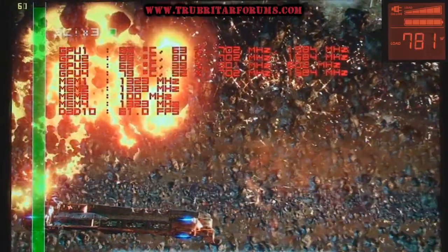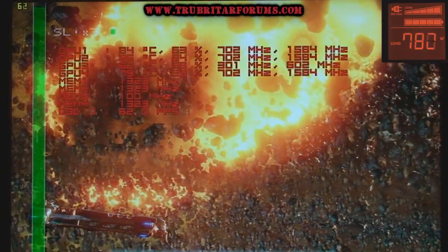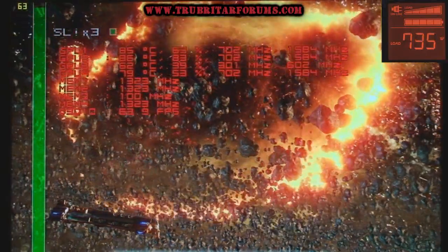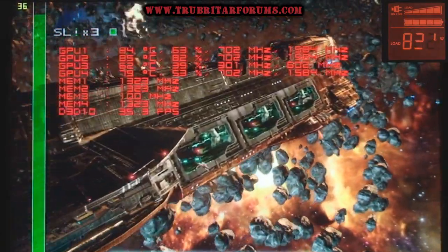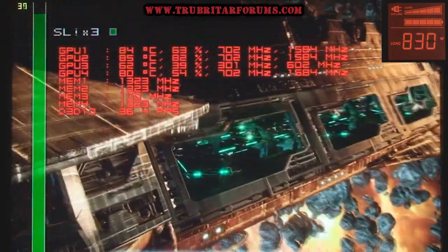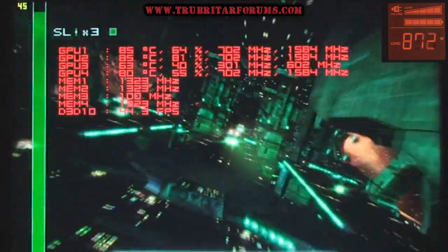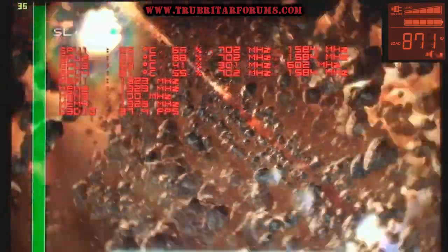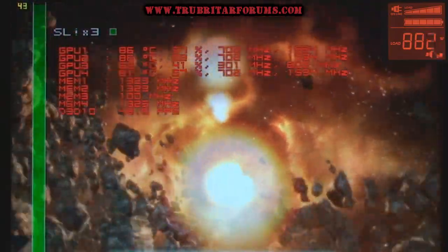So here you have it. Our GTX 285s are running as GPU 1, GPU 2, and GPU 4. Respective temperatures: 85, 86, and 79 degrees. One thing that's interesting — in the previous video with two water-cooled GTX 295s, the physics card, GPU 3, was actually running 23 degrees cooler using water cooling on the surrounding cards. So obviously those air-cooled cards are passing a lot of heat through to that physics card.